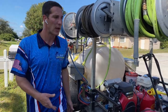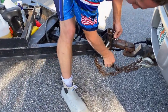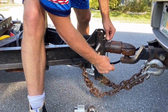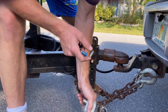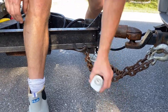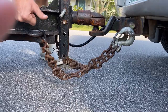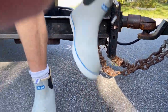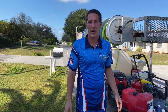Security matters for the whole trailer too. I lock my trailer hitch — not just a regular pin. If someone gets the pin off, they can collapse the collar and pry the ball out. With the ball in and the locking collar in place, there's no way to remove it. I also purchased a pin that goes through the actual ball hitch so it can't be removed. When you have thousands of dollars wrapped up in your trailer, spending an extra $50 on security is huge — losing a $5,000–$10,000 trailer over a cheap lock is not worth it.